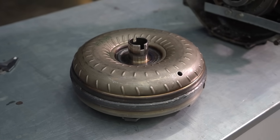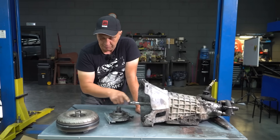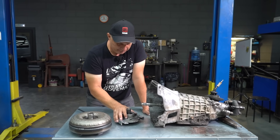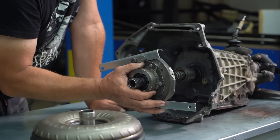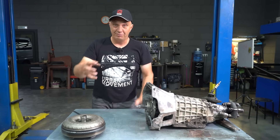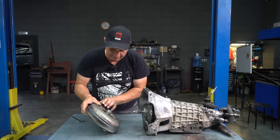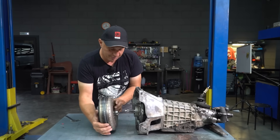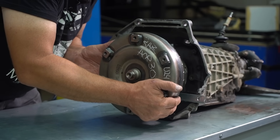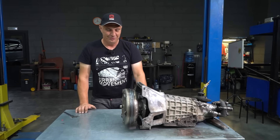All right, so we've finished the input shaft — we extended it, the diameter plus the splines are tailored to the torque converter. We've also set up this lovely thing: with the splined hub like on an automatic transmission that secures the pump, it's supposed to stay put while the internals do their thing. All of that is secured and where it should be. Terrific — and there you have the complete assembly.